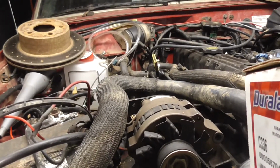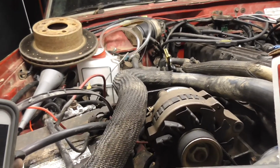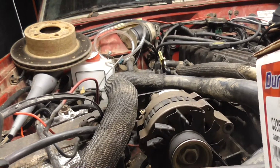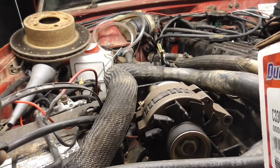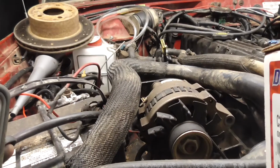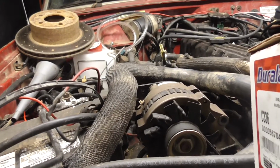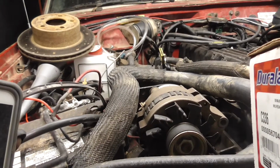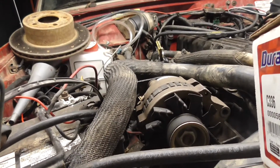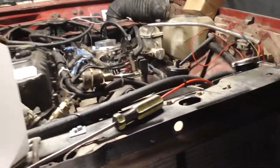The motor oil I'm going to use with this right now, I just have STP in there with a little bit of the zinc additive from Lucas. Not much, just a little bit. I'm going to run some cleaner through it because the oil that was in it was really thick, almost like gear oil. I'm going to run an engine cleaner through there, kind of like we use at work, drain everything out of it, and then I'm actually going to use 10W-30 Rotella with that zinc additive. I'm going to run Rotella in this motor, just because.